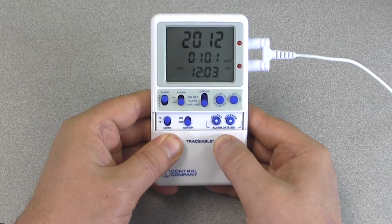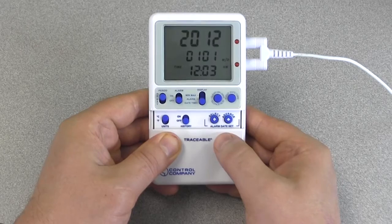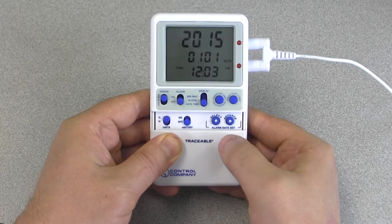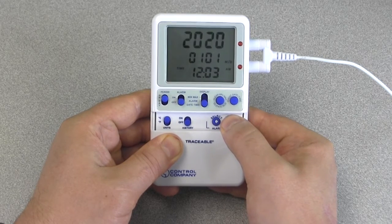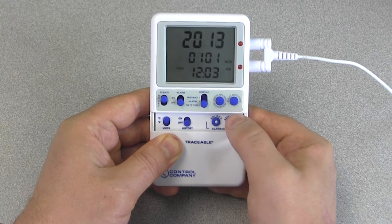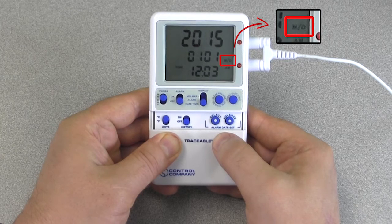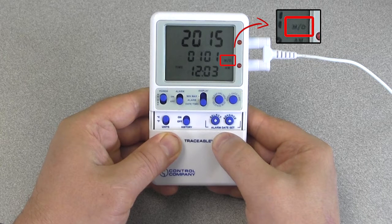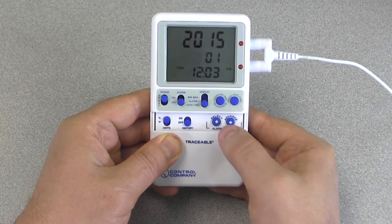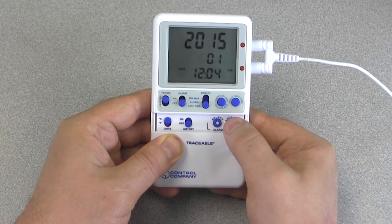While flashing, pressing the advanced button will increment the value. In this demonstration, we will press select and the year will begin to flash. Tap the advanced button and the year will increase by one. Press and hold the advanced button and the year will continue to increase until you release the button. If you pass the current year, you can continue to hold the advanced button past the year 2099, and the thermometer will recycle back to 2012. Press select and the month will begin to flash. Check the format icon to the right — it shows whether the month/day display order is month-day or day-month. Press the advanced button until the chosen month is selected. If you skip past the current month, continue to hold the advanced button and the thermometer will recycle back to the first month of the year.